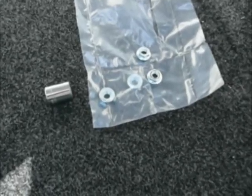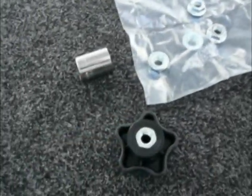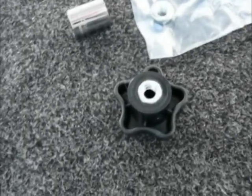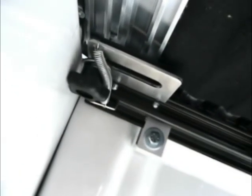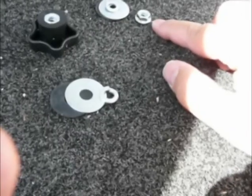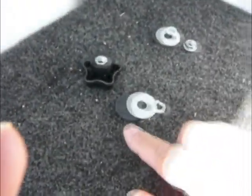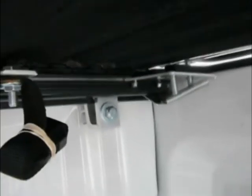Didn't I say there was going to be more surprises? In the installation video and the installation pack, they tell you to tighten up the front end bolts with this star nut. But because there is a spring on that mounting plate, the star nut won't turn. You're going to have to use one of those 13mm supplied nuts. Again, not in the instructions. I think I just figured out their modifications. You got one 13mm nut, lock washer, washer, rubber gasket. You get a star nut, rubber washer, regular washer, lock washer. And you get two bolts to put in the sucker. Now, that is more secure going down the highway. But if you make the changes, give us the instructions. You sent your kids to school to be an engineer — teach them how to install this crap.